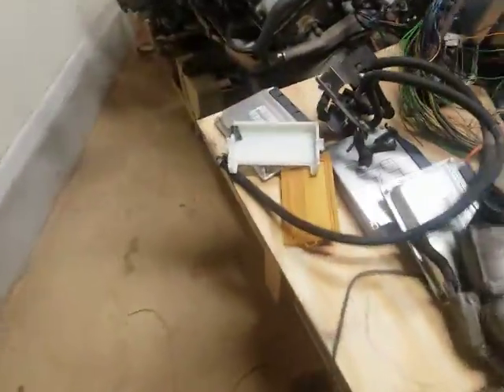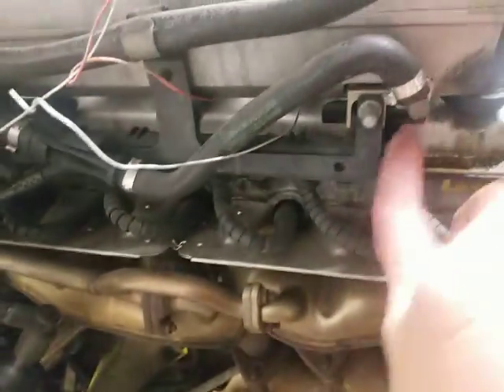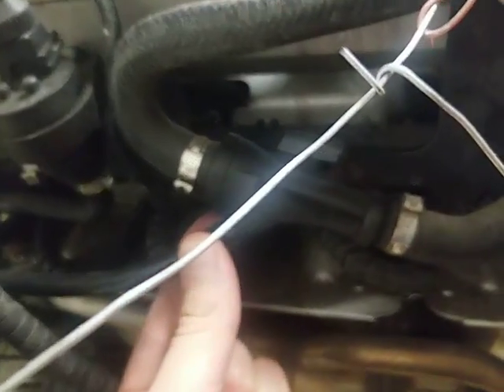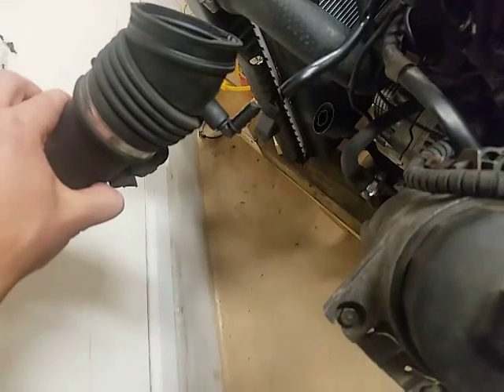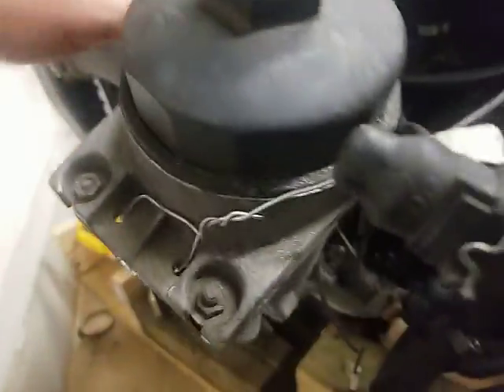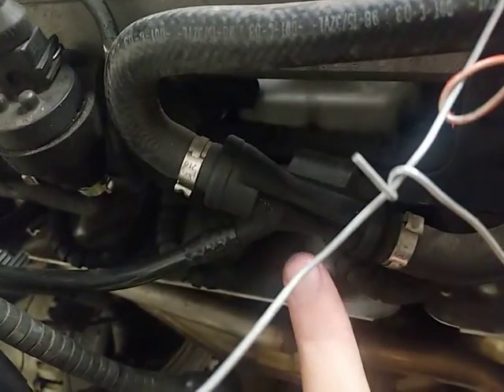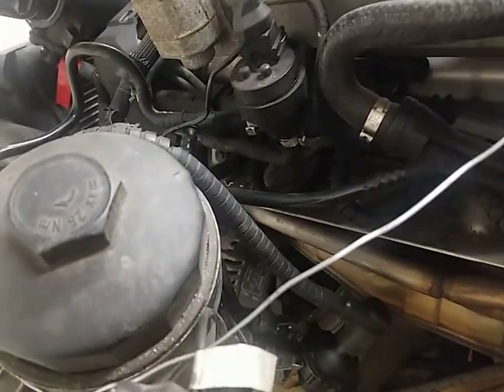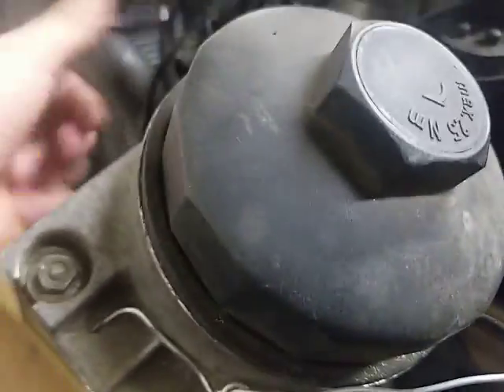Let me go across. Here I have another big nipple that seems like this would be brake booster. This is some plastic magic. Then again a hard line which again goes into this intake pipe before the throttle body. So again there's a tee over there and then there's this plastic and then this large angle tee. I wonder if there's a valve somewhere or not. Again a solenoid, and again the stuff after the solenoid is this.